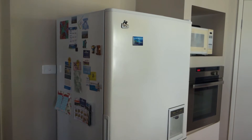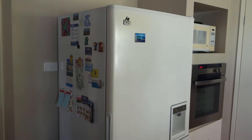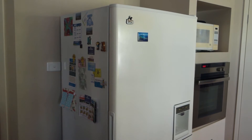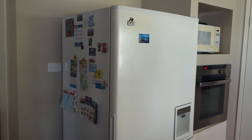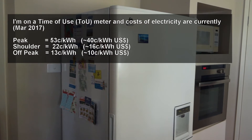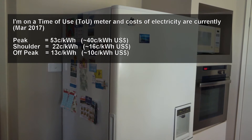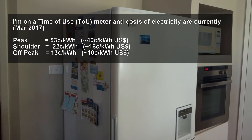Now, load shifting — the idea of load shifting is to cool the fridge and the items in it at a time when electricity is cheap. I originally did this two years ago so that the fridge would pre-cool all its contents overnight using cheap electricity, and then during the day the temperature would be set to a higher level and obviously not use as much electricity.